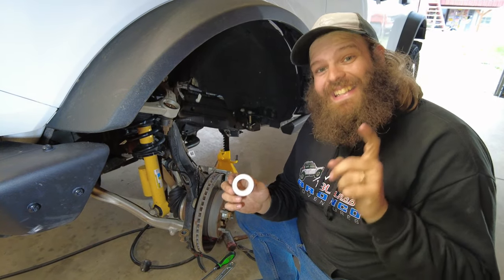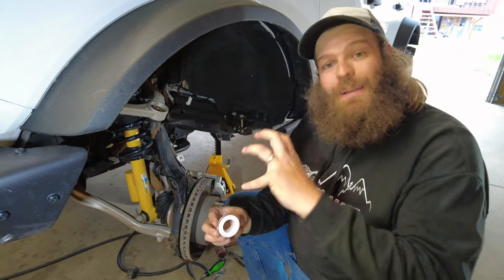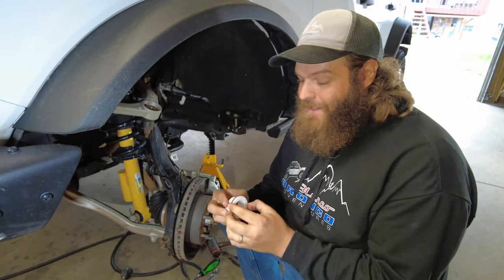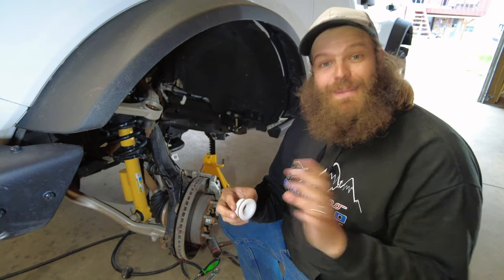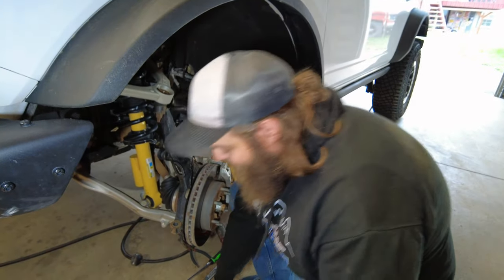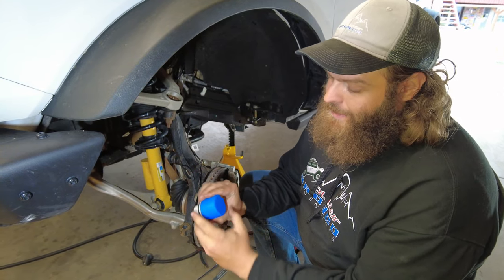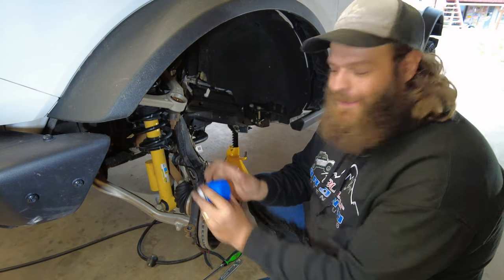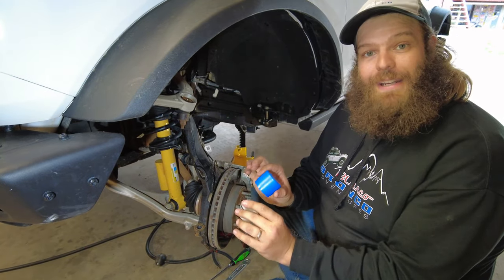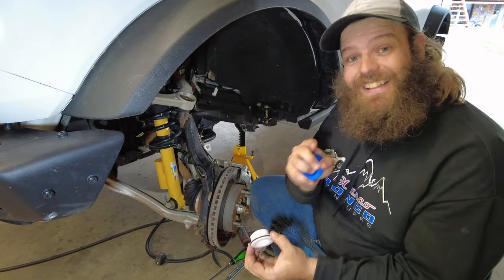A couple things of note - this is fancy plastic, it's not just regular old plastic; there was some thought and design going into this. Also, the o-ring is just there to take up a little bit of the space. So if you knock this in and a little bit of the o-ring comes out or kind of tears, that's totally fine - that just means it's making a good seal doing what it's supposed to. They've even got you covered with an install tool. Once you get this in place, put your install tool there and give it a couple rat-a-taps with the hammer and it will seat right into place. When you can feel the hammer bouncing back off of it, you know you're fully seated in there. Then all we got to do is install our snap ring - it's literally that simple.